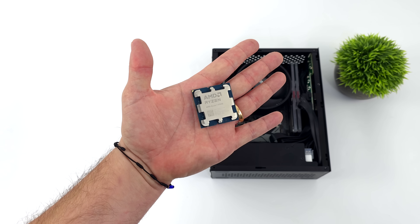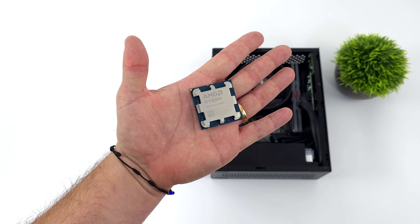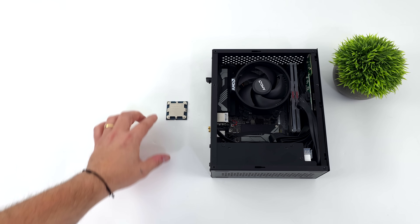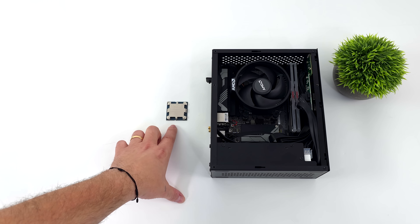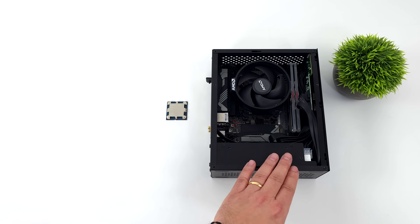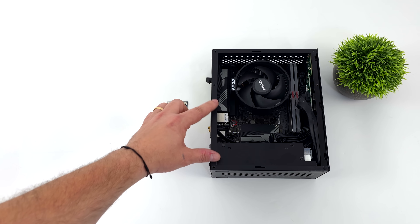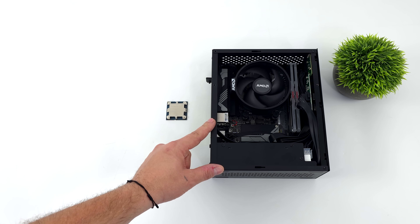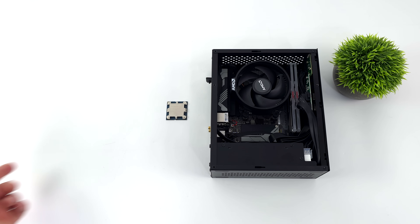What we've got here is the all new AMD Ryzen 7 8700G. This is the successor to the older 5700G. With this, we do have RDNA 3 graphics — we have seen these in mobile before, but it's the 780M clocked up. With this setup, I'm actually going to be doing an overclock on that GPU up to 3200MHz.